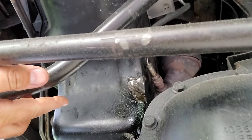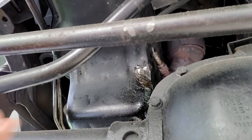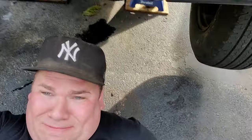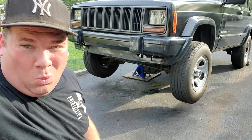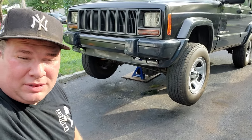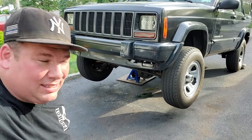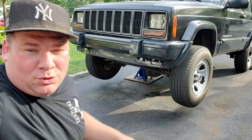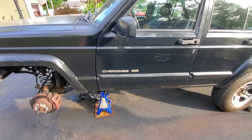This oil leak was caused by damage from the axle hitting the oil pan during the accident. We had tried to fix it with JB Weld and it lasted for a while, but as you can see it didn't hold up. So we are lifting the old Resurrect XJ, and while the axle is dropped for the lift, we're gonna get at that oil pan — do an oil pan, a rear main seal, an oil pump, and of course a new oil pan gasket.